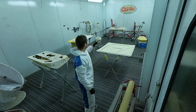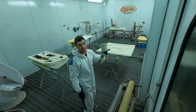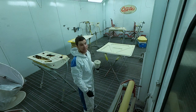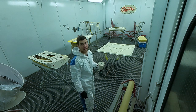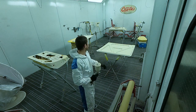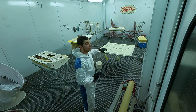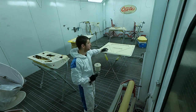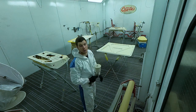All right, I've got the bits in epoxy primer now, so I'm going to spray the red on now. I'm using the Iwata, the Supernova. I've had this gun for about 10 years now, and it's mint for direct gloss, lacquers and all that sort of stuff. So yeah, I'm going to do 2 or 3 coats on these, give them all a tack off, and then once they're dried and baked off, we can mask them up, final prep the outside, and then do the rest of the shell and everything with the outside all in one go.